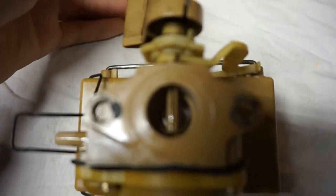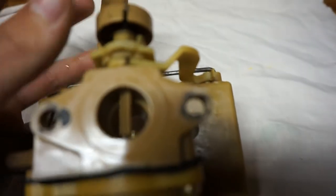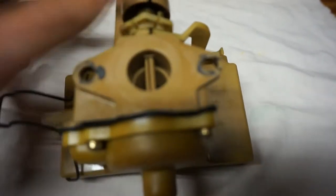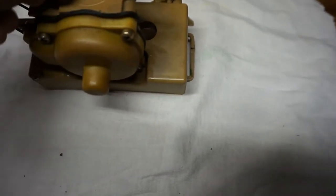I've got the carburetor on the workbench. I found out that whenever you put in the little disc, the governor arm actually pushes down into a little hole, and the disc is what keeps it from moving up and down. Here's my disc. There are these little tabs — you can see the shiny part. There are little half-moon tabs beside it that you're supposed to bend open, which prevents it from sliding through the slot in that center shaft. I'll get the camera set up on the tripod and show you what I mean by that.